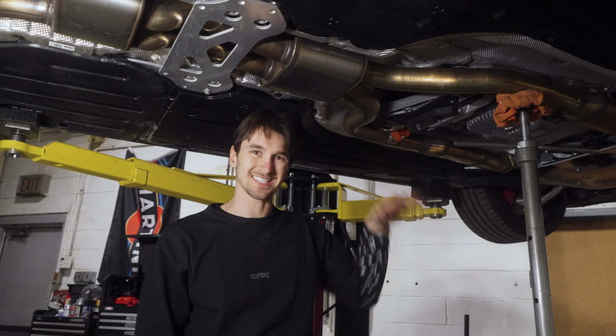Up high here. It's loose. Then these can be spun off by hand, which is nice. And this one is the same thing. You can do this all by hand. It's important, again, to do this by hand with your fingers, because if you do it with the ratcheting mechanism of the wrench it will get stuck up there, and then you're gonna have to put a pry bar on the trans to shift it over so you can get the bolt out. But we recommend just avoiding that altogether and doing this with your little fingers.